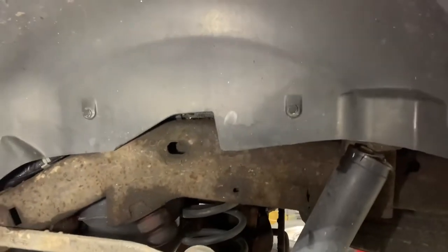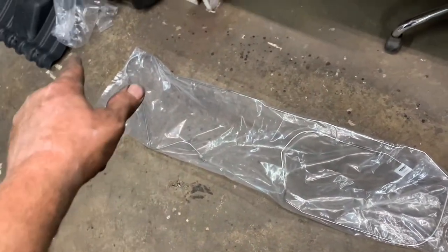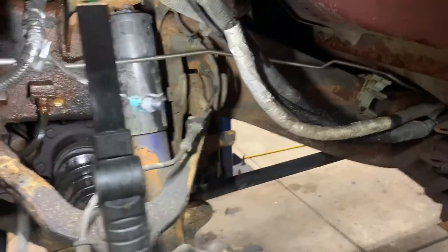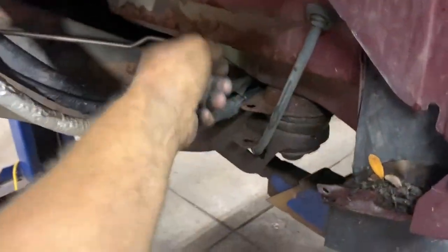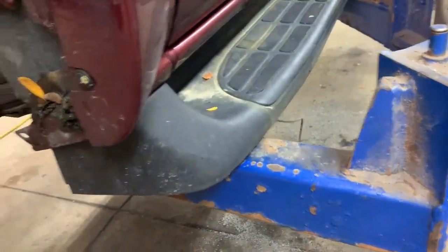Inner skirt's in. Now we work on the right front — it's the longest one with all the loops. Get it out of the plastic and straighten your spots where the white tape is. Take the long part of it and shove it behind the wire harness and the washer hose, then shove it down through here and keep on pushing it until it almost bottoms out. Now it's dangling down there.